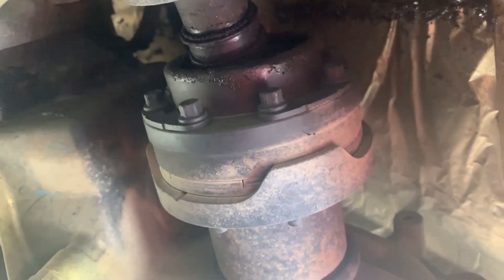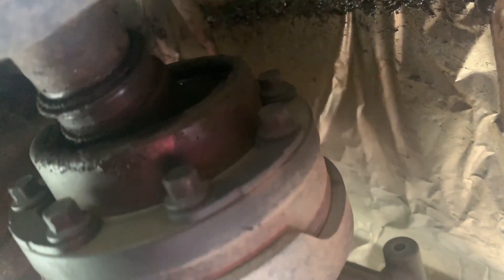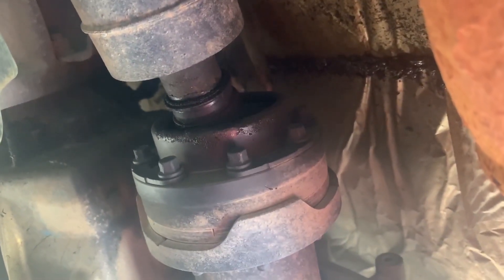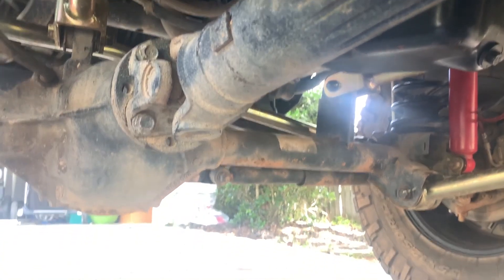Jeep is cool now. We're going to start by taking these bolts off — they're 8mm, pretty small. The ones at the top I'm going to have to pull the Jeep up a foot or so and have the drive shaft rotate so I can take those out. You can remove your whole skid plate system if you want, but I'm going to hard pass that one. I'll take the small bolts first, then take out the big bolts in the back.